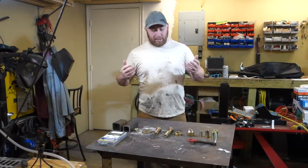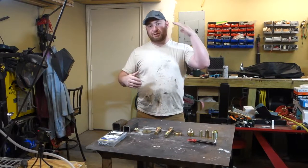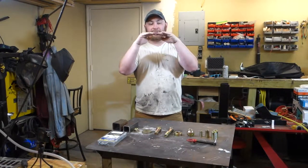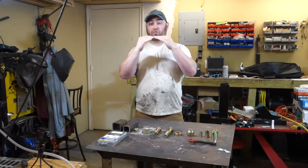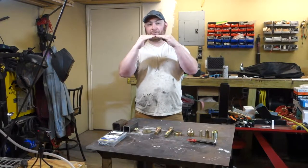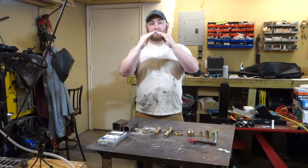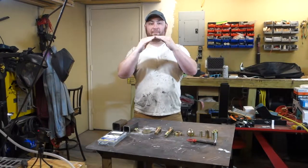So, what is a three-way articulating hitch and why is it important? Imagine if this hand is your truck and this hand is your trailer. A standard ball hitch is really good at doing this — basically, if you make a left turn, the trailer follows you around the curve. Works really, really well. Unfortunately, off-road, this is just one axis we're concerned with. There's also this axis as you're going through gullies and over peaks and stuff. A ball hitch will do a little bit of this, but it won't do a whole lot of that without popping off.